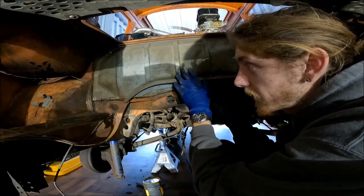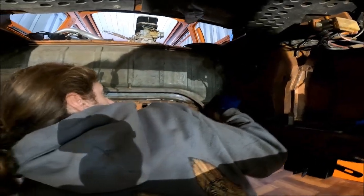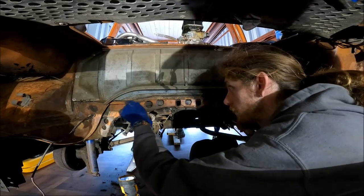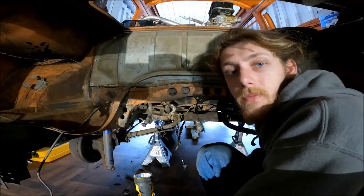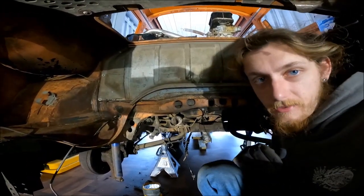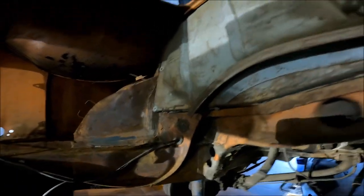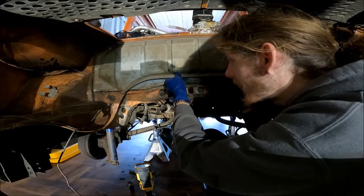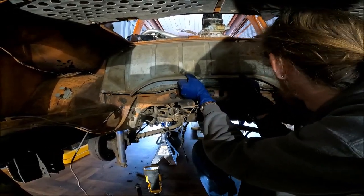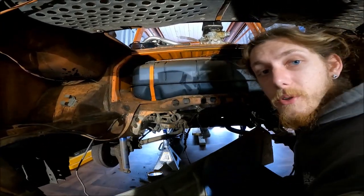But anyways, so we're removing the gas tank. We got to pull this panel off to gain access to it. So there's 1, 2, 3, and 4, 5, 6 Phillips head screws that hold it in, and there's a seal down here, which I removed as much of it as I could to gain a little bit of wiggle room. Still couldn't pull it out, and it was just beating me up. But I found out that right down here, up in this area, on both sides, there's an extra Phillips head that holds it in. So you get all those out. You're probably going to need a little bit of manpower to yank it out, just because it's been sitting in there for God knows how long. But you pull it out, and then it slides down out of the top, and there's your fuel tank.